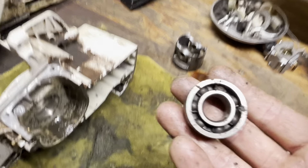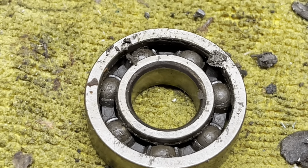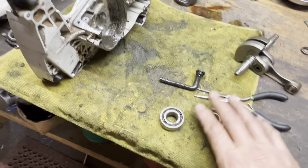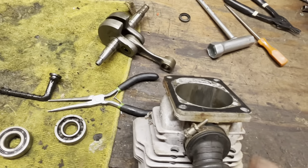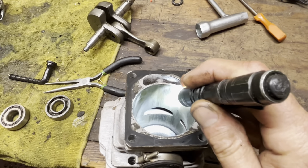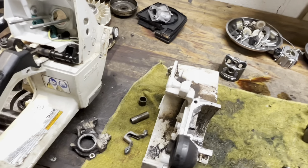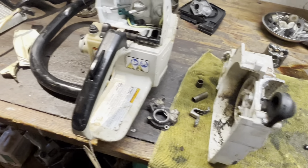As far as the bearings, I think we're seeing some rust issues here. I'll get you in nice and tight, but they're crunchy. The plastic cages are not melted — there's plenty of heat going on to leave that kind of transfer. But this jug's going to clean up nice. No performance work here; we're just going to do new bearings, seals, gasket set, clean up the used cylinder, and put a brand new Meteor piston in there, which will be just fine.